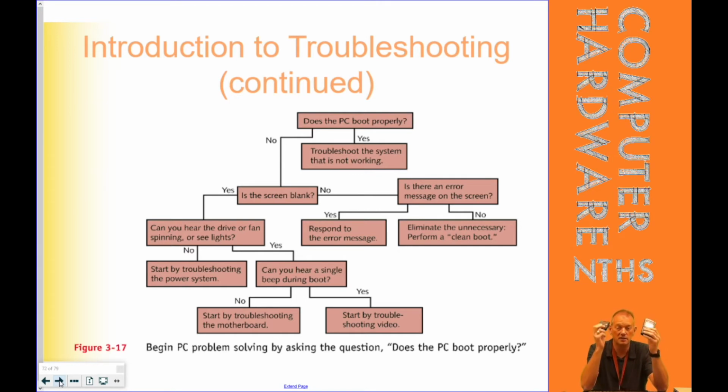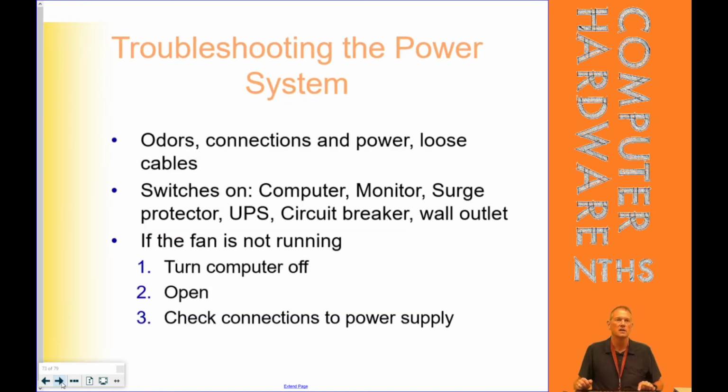Basically, if we've got a clean power signal and we've got the jumper set correctly, as I said, it could be the button. I've had buttons go out before where I had to take a small screwdriver and just close that connection between those two pins to get it to boot, and then all of a sudden it booted, and I knew it was the actual button itself going to the power supply jumper on the motherboard. So those are just some basic things, they're starting to learn about troubleshooting.